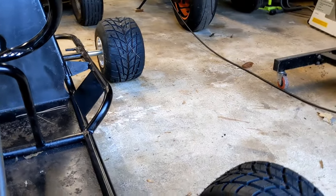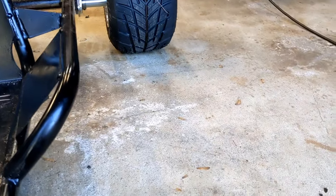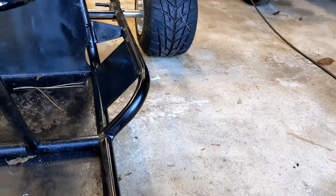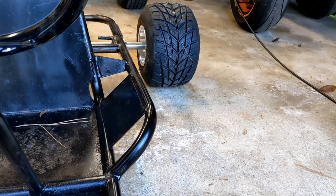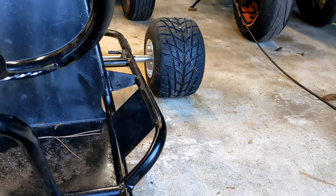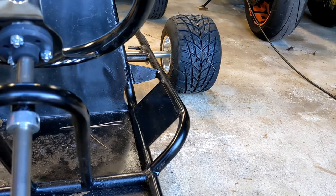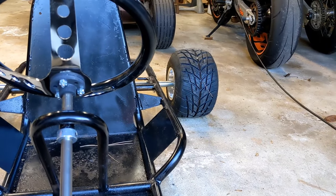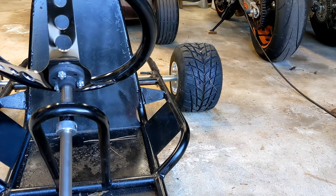Less weight on the inside wheel — which comes back to the live axle — and you can actually see it lift right up off the ground. While you want to get all the power to the ground, when you go into that corner and pick this inside wheel up just a little bit, it will allow it to slip on whatever surface you're on so that the cart will want to turn. It's actually still going to want to go straight because of the axle, but it will allow that wheel to slip and let it turn more easily.